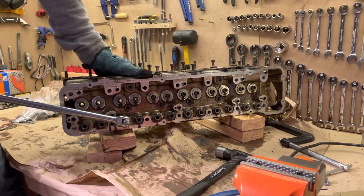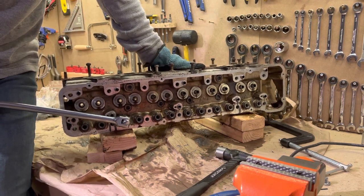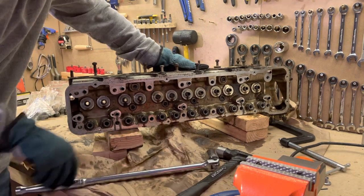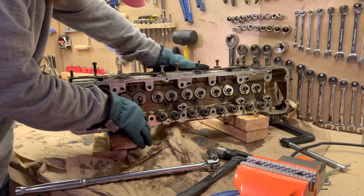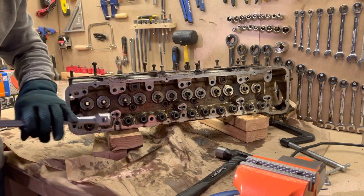Next you're going to be removing the rocker bushings — I had a really hard time with this. The book recommends taking a box end wrench, attaching it to the hex as best you can, and shocking it with a hammer. There's not a whole lot of hex area to grab with the edge of the cylinder head there, and I didn't have any luck with that method after trying a few different times at a few different angles.